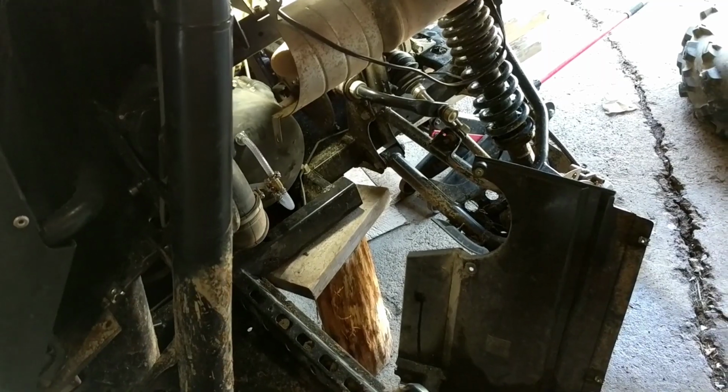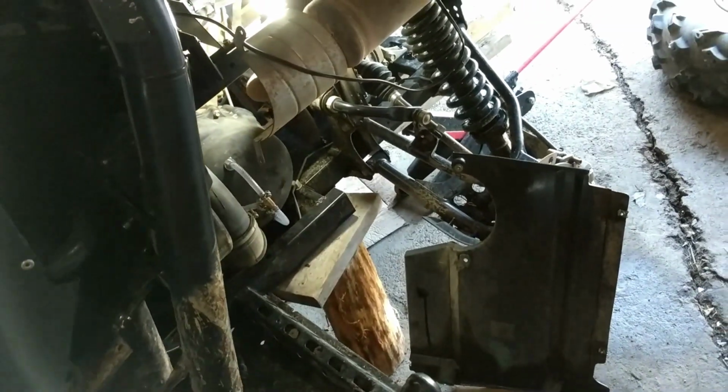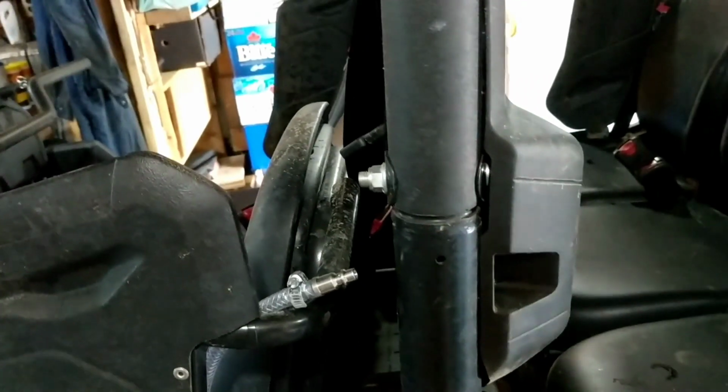So now that this is all ready for use, I just tried it. Not much came out, but it was just cleaned. I mean, it's only got 75 miles on it, since I did the clutch work. So anyway, you just want to give it the air right here. Have the engine running in neutral. Rev it up. That makes your primary spin. It's spinning. You give it the air here, and it should blow all the dust, whatever, right out of your exhaust. And that should be it.